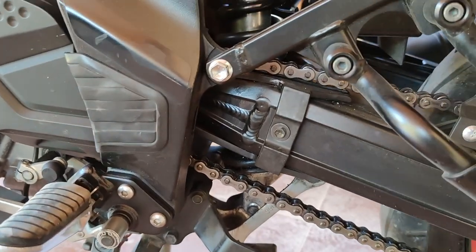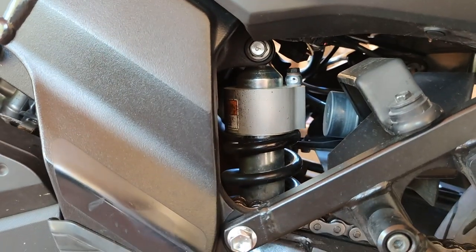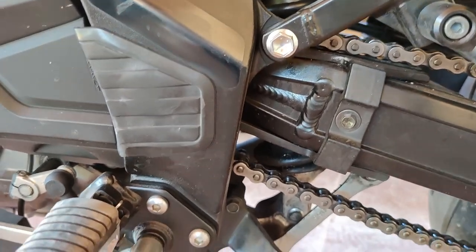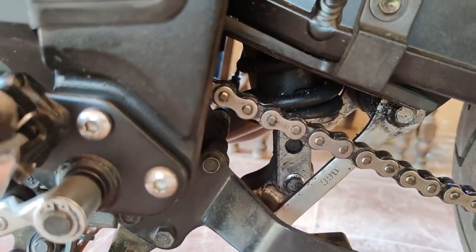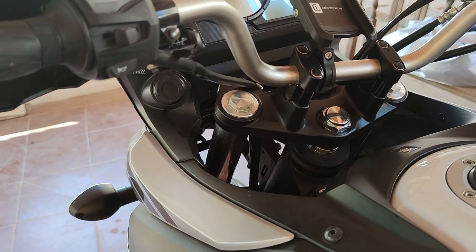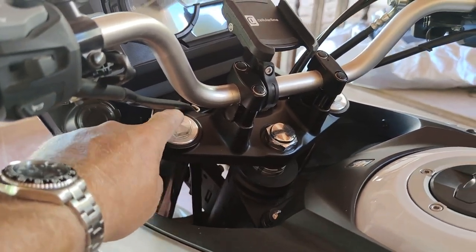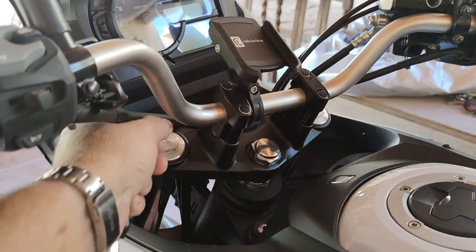The back end's great. Providing you carry a screwdriver, you can change it on the fly. The hand dial is enough to change the rebound on one side, and you can change the other one if you've got a small screwdriver in your bag with you. The ones they sell on eBay come in two types. One is a screwdriver-adjustable end cap, traditional, where you put the screwdriver in and wind it in or out, and the other ones have a dial on them, so you can do it manually